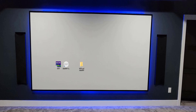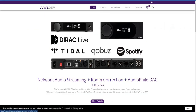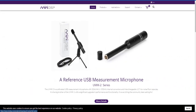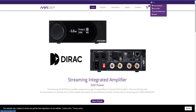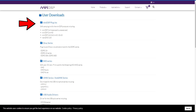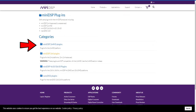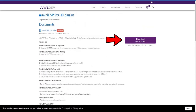Okay, we're at the desktop. We're going to get the software and get it installed. Open up a browser and do a Google search for MiniDSP. Find their website — you do have to create an account. I created an account and ordered my MiniDSP 2x4 HD directly from them. After you log in, go to the drop-down box that says User Downloads. Find whichever device you have — here's the MiniDSP 2x4 HD right at the top. Click on it, find your download file, click it, download it, and install it.